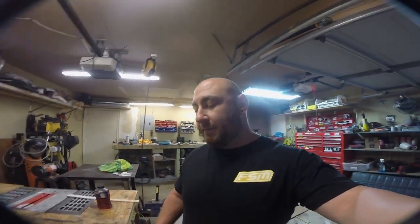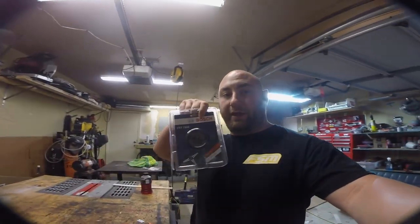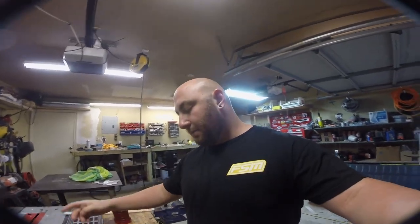Today I'm going to show you how to install a basic Bosch tach into the K5 Blazer. This install is going to be very similar to any of the old square body trucks or any of the Chevy cars, for that matter. In terms of wiring, the general principles can be applied to installing an aftermarket tach in pretty much any vehicle that has a distributor — single coil.